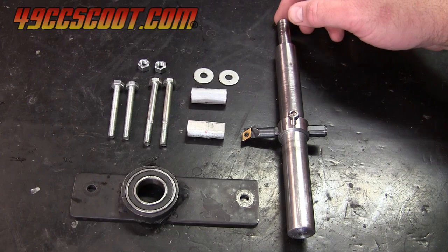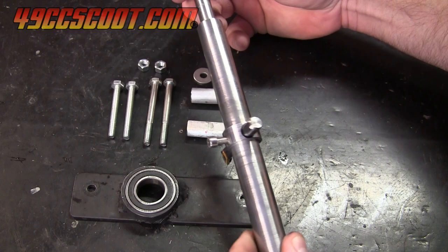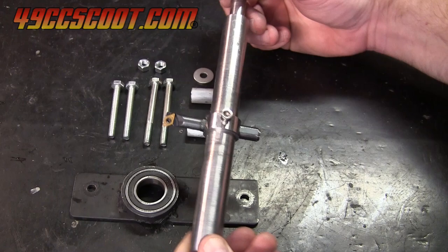This shaft was cut from 4130 steel with two sections just shy of 20mm that allow it to move through bearings with a 20mm inside diameter, like the 6204 crank bearings in these engines. The divider between those sections is larger to act as a stop.